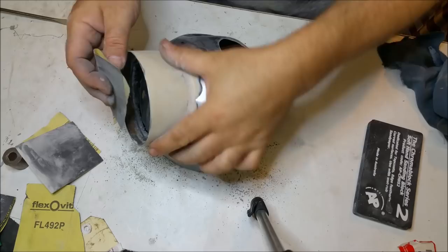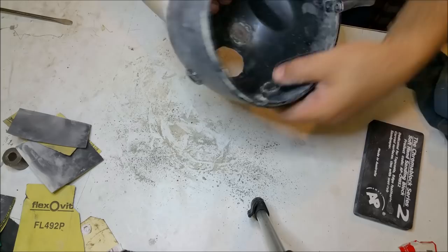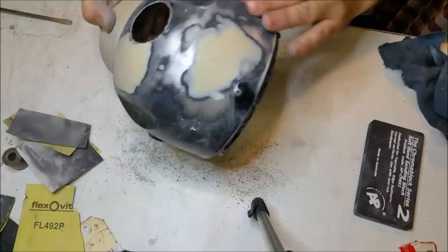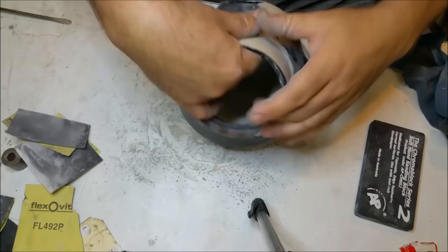Back to the headlight. We're just giving it some light body work. This was quite weird because it's a stamped piece of sheet metal. It was actually quite thin in some areas. It's got two patches in there, which aren't done terribly well, but it doesn't matter because it's nice and smooth on the outside. So I blocked up that one and that one. I've made this one here, which again isn't great because the hole saw was walking, because it's very, very thin. But we've welded that on.